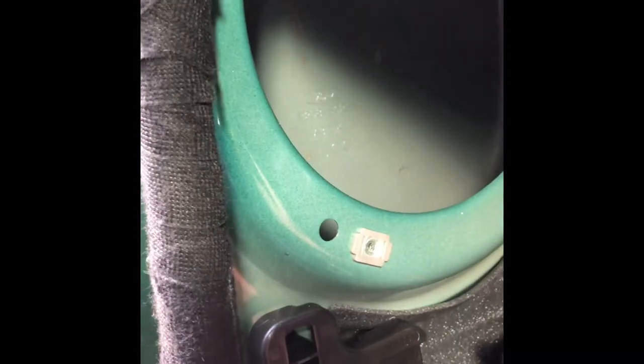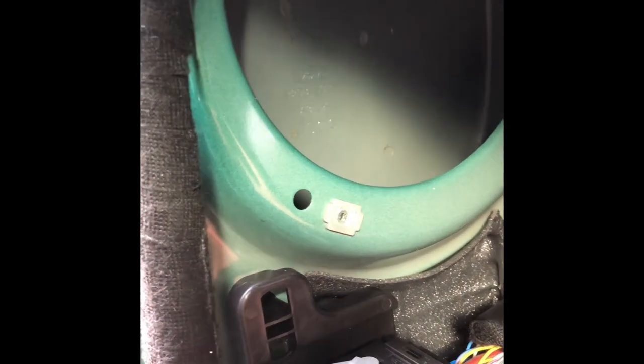There are three seven millimeter screws — up here and to the side. When you pull this thing out, that's what's behind there. As far as airspace, it's not bad — I might throw a piece of Dynamat back there. Let me get started with the new Kicker. It's a little difficult to see but you do two clips — usually the first and third, so every other one, and then you can put two of them in the same clip. I'm going to run my wire through this little slit that I cut, so I get the speaker positioned properly.